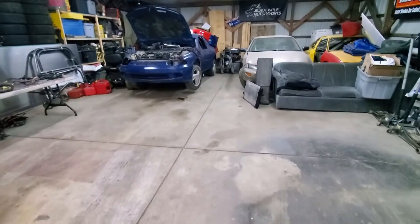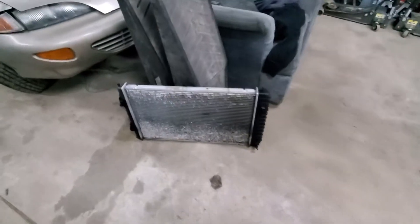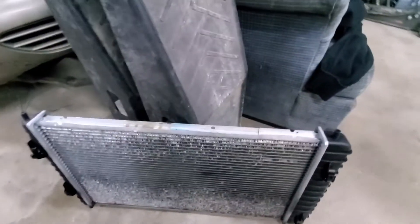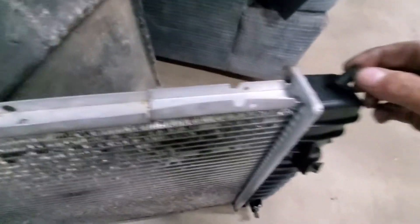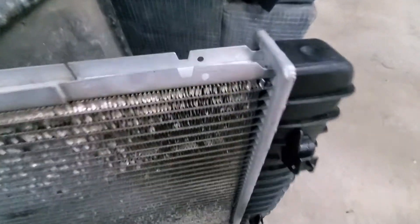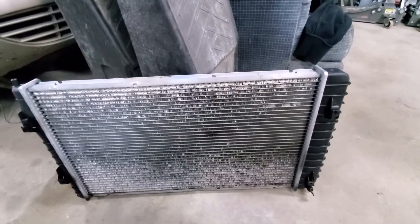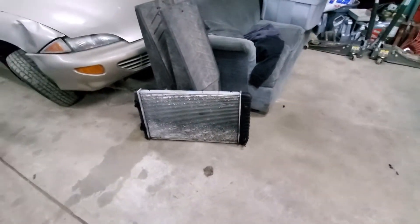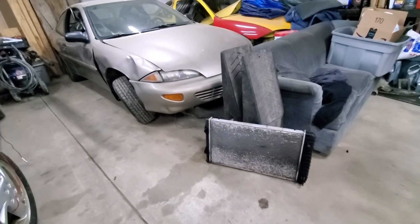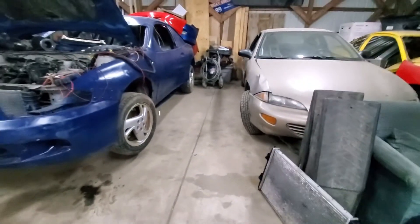Oh, one more thing — we were checking our cars before racing last Saturday and Alex bumped my radiator hose. We noticed coolant shot out of the front of the radiator, and it turns out the mount broke off the top of the radiator — it was actually leaking coolant. It didn't get hit by the front end of another car; it was clay that came through my bumper and knocked it off. There was a big wad of clay right there. It's a first for me. Sad to lose that radiator because it was a new one — that's what you get when you're racing dirt.